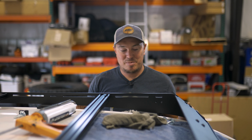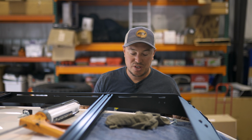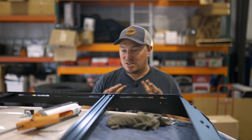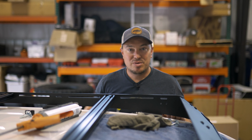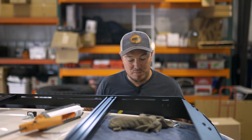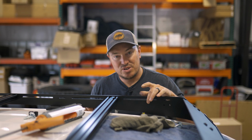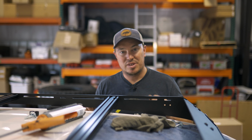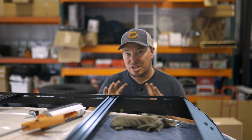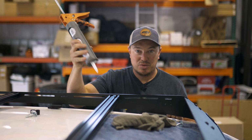Okay, so roof rack's up here. Now we're gonna start getting our spacers in place and siliconing our holes. The silicone we're using, it's black RTV. It's weather rated, it's okay for UV rays, all that expansion and contraction that'll happen from summer to winter months. We've done 2 layers. We have a base layer underneath the plus nut, and now we're gonna have another layer on top. So this is gonna be a really superior weather tight seal. So without further ado, we'll get them gooped up.